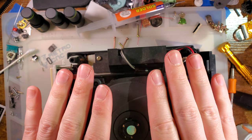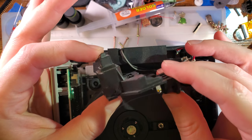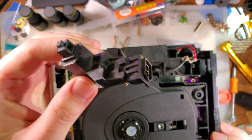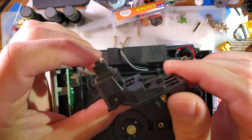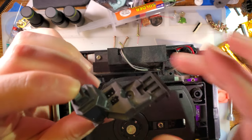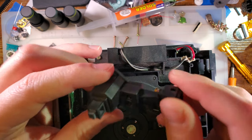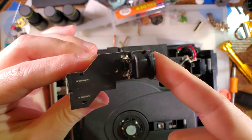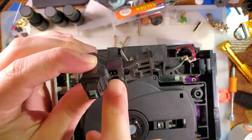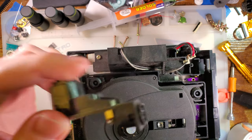Alright. So, I've just done some research before continuing, and I have learned that there are two variants of the GameCube Power Switch, and of course I have the one that is not compatible with this mod. The problem is that this Power Switch is a full custom switch from Alps. There is no PCB here to solder to. It's just plastic, and then we have bus bars on the inside connecting the power input through this switch to these two connectors. So, unless I were to interface between this plug and this board, I can't do this.